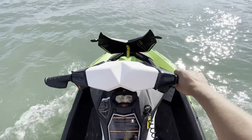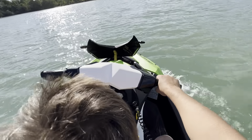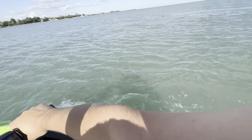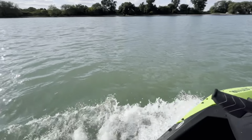This is a blown wear ring on a Sea-Doo Spark. You can see it's going almost full throttle and doesn't even have enough speed to plane. This is just from excessive clearance in the prop and the wear ring. I'll show you what the diagnosis is, but this is how it looked.